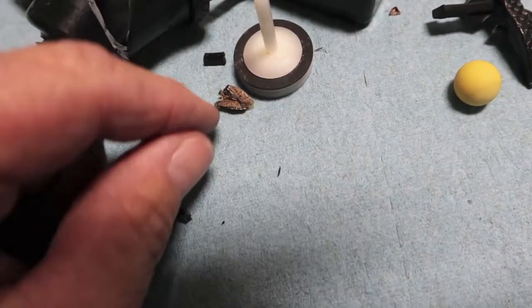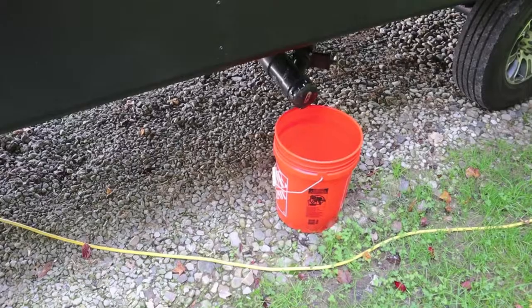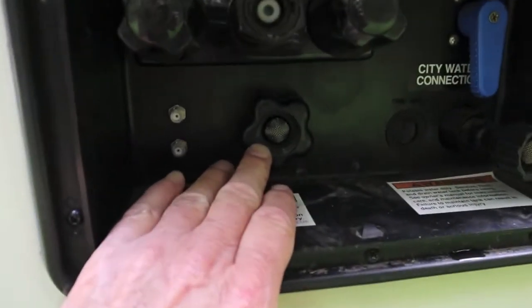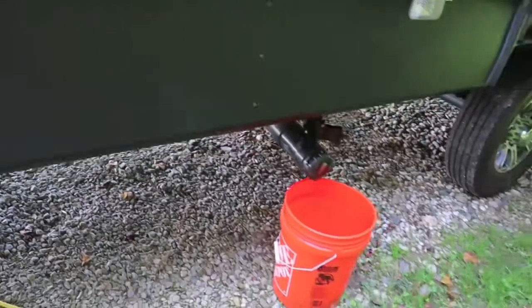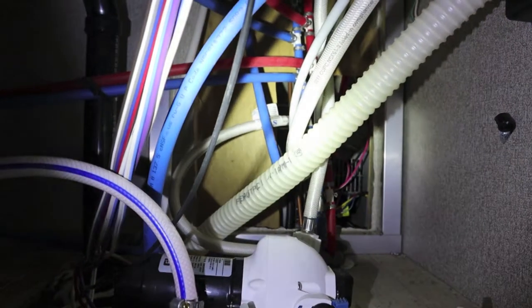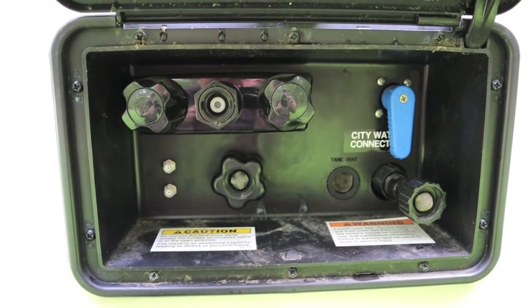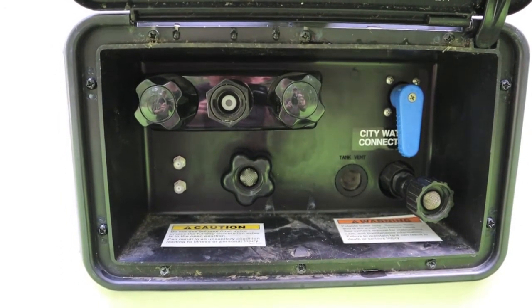It would have worked fine had that bug stayed out. I went ahead and put a screen mesh around it using a zip tie — that way it can still breathe where it's going to atmosphere but it should keep out large bugs. Anytime you're doing the black tank flush, when you turn the water on at your spigot, it's a good idea to stand back and take a look. If you have an access port like I do, all you gotta do is stick your head in and check that blue hose going vertical — as long as that's staying dry you're in good shape. If you have any questions please don't hesitate to ask in the comment section. Thanks for watching and travel safe out there.